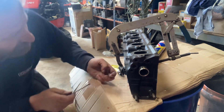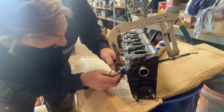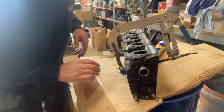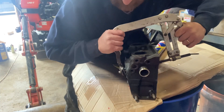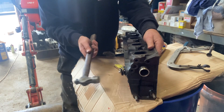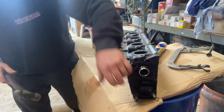There's a groove machined in the top of the valve stem that these collets sit in. When you get both of them in to where they're supposed to be, sometimes they can be a bit fiddly — the spring's probably not pulled down exactly square. Let it go, and then you give it a tap with a hammer to make sure it's all home properly.